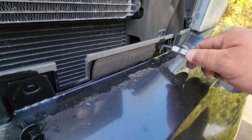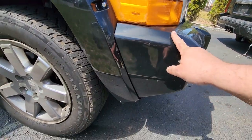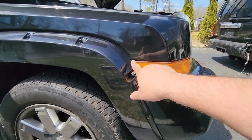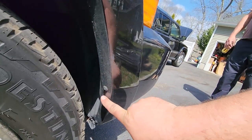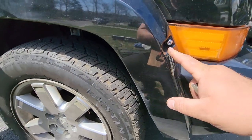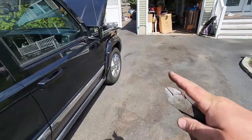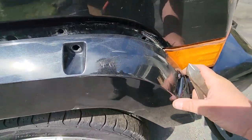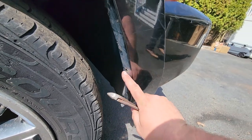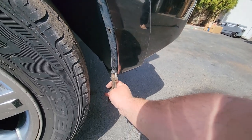Thanks local Rob. For demonstration purposes, over on this Jeep we've got this fender flare mounted — it clips right into the fender, also clips into the bumper, and it holds everything together with these plastic rivets. There's two at the bottom and a couple at the top for the fender. What we're gonna do is snip the bottom ones, and hopefully the clips will pop out. These clips are probably broken, but we'll see. We're gonna try to separate the bumper from this fender flare. This one's already busted from the accident.